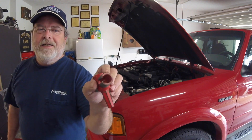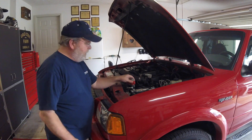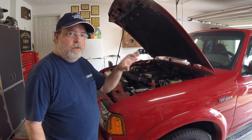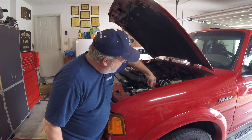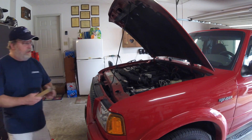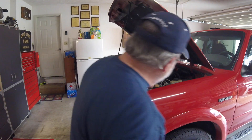You see the negative up in there? And the positive up in this one. Negative to negative — get this down to some clean lead here. The reason you've got different sizes is because negative is always just slightly smaller than the positive on a battery post. I might have to get a little wire brush and work on this a little bit too. I don't think I have a small wire brush — all I have is this behemoth right here. You don't want to breathe that crap in either, because it's got a nasty smell and it brings a metallic acid-y taste in the back of your throat for the next three days.